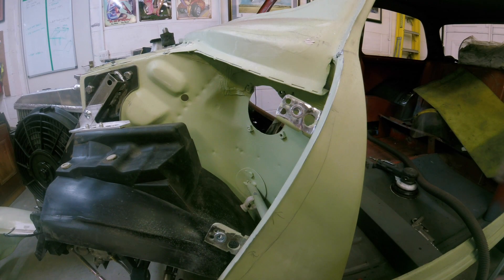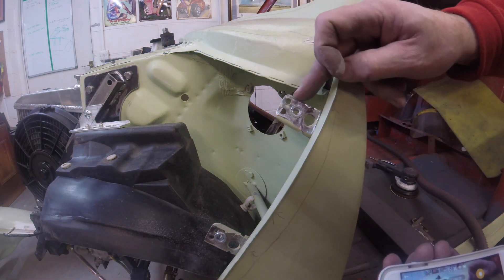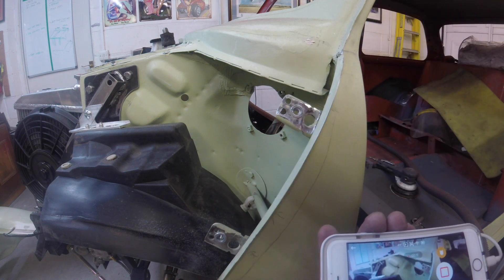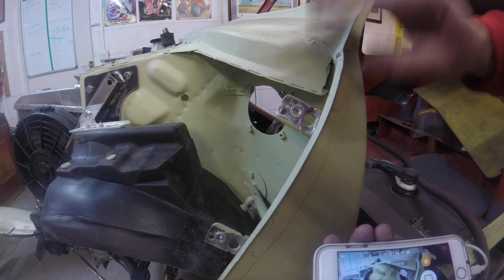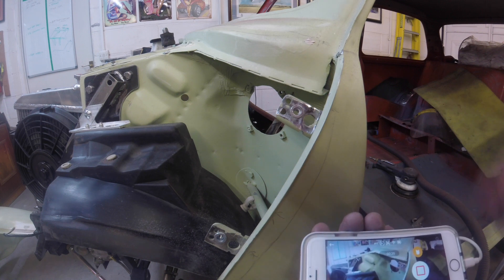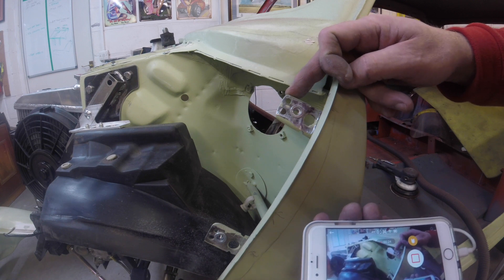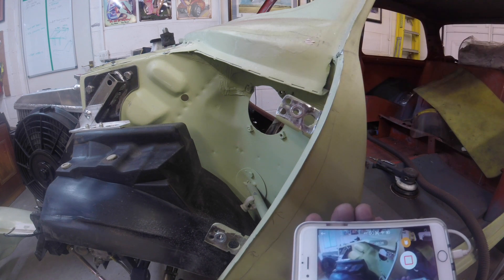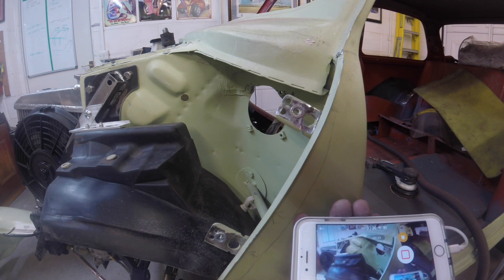One thing I forgot to mention: you'll have to fix some little tabs — I've put two tabs in my case — just here to receive the front end. I've got metal A-panels welded on; they're all in good condition, new panels. The first thing you need to do is make sure this area is quite sound. These are just made from a little bit of cut-down box section, all with rib nuts in ready. I'll now get the front end on and show you it clamped in place.